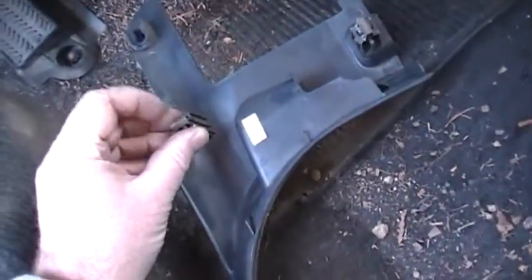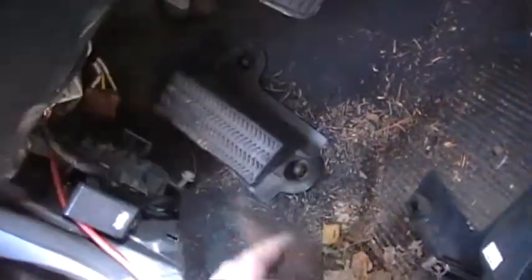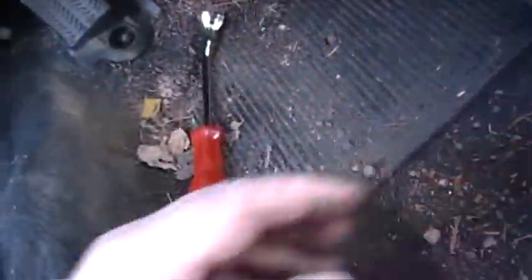Okay, I'll show you what I've done so far. I got to disconnect some cables from the dash here. And so I popped off the fuse box. You just twist this little deal and the cover comes off. And then there's this piece that sits up here. The way that works is it's got metal tabs here, and then this little plastic slider deal. So I just use my panel popper screwdriver, set up and pop this out. And the other one, I think, yeah, it's up top there, so pop that out. That's how I got this off, and that makes it a lot easier.